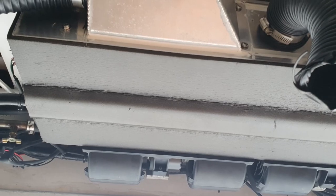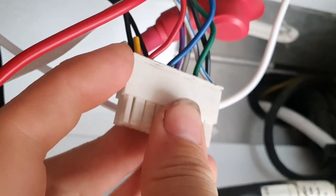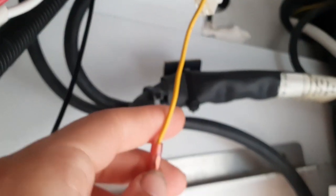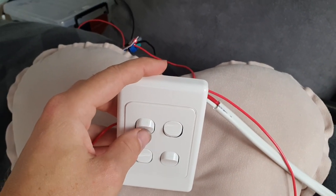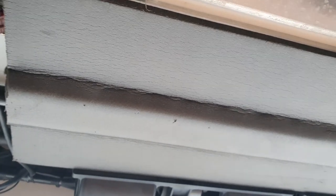If you want to use your evaporator unit as a heater as well, all you have to do is cut this yellow wire from this plug. I've already cut it — that runs the water pump. There's the fuse for it and there's the relay for that. That yellow wire only goes to the relay. I attached red, because it's positive, and this goes to my switch. You can turn this on — you won't really be able to hear it, but the water pump is on now, so it's circulating coolant through this box, which it can then run air over to heat it up and then you have hot air as a heater.